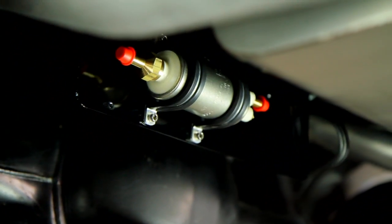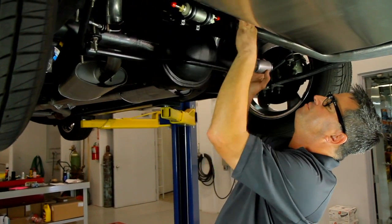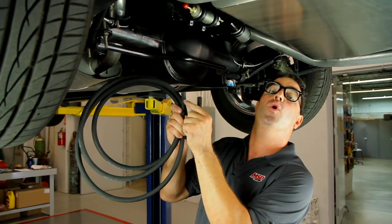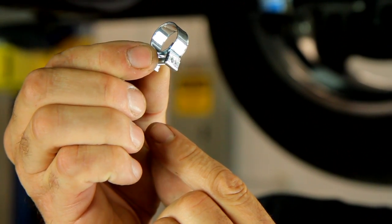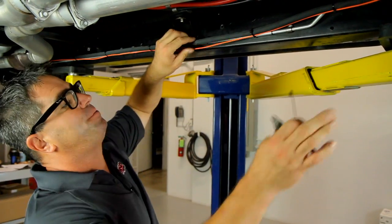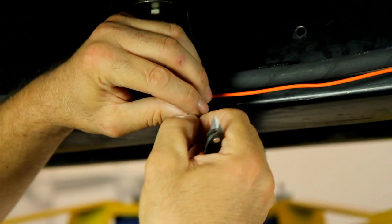With the fuel pump installed, we have to remember that clean fuel is critical to proper operation of any fuel system. The MSD fuel pump kit comes with a canister-style fuel filter with a 3/8 inlet and outlet, totally rated for the 60 psi the system operates at. It comes with its own vibration-isolated clamp. The MSD fuel pump kit also comes with several feet of high-quality woven fuel line — enough to do the whole system. We'll cut pieces as we need them. Be sure to use high-quality EFI-style hose clamps included in the kit. Don't use the old snap rings or the screw-and-bevel type — they're not rated for 60 psi, and you don't want fuel leaks. We'll also run the orange fuel pump feed wire from under-hood back to the positive side of the pump, and the negative side gets a ground wire to the frame. Route all lines and hoses away from heat sources, pinch points, or anything that might chafe through them.